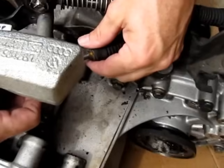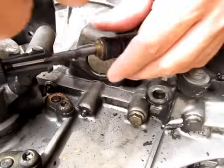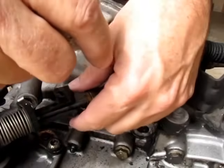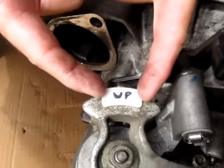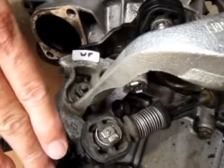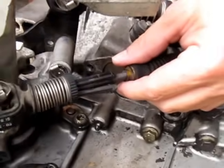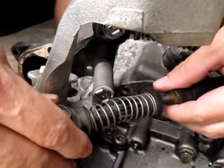Do the same on the front-to-back cable, pulling all the slack out. Then the next step after you've done the side-to-side cable is to rotate it back into neutral. In neutral, this white slider is going to be in the middle of this chrome piece — that's neutral. It won't move up and down at this point because we have the shifter locked inside the car. Once you have this back in neutral, go ahead and pull the slack out, then release the cable end.